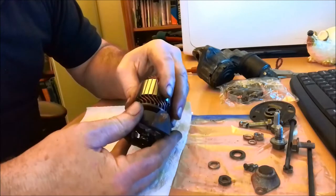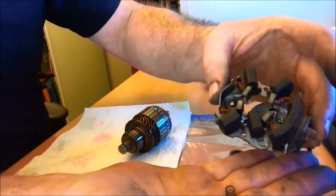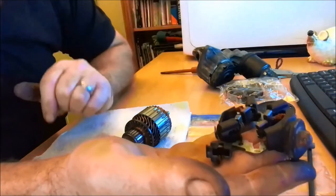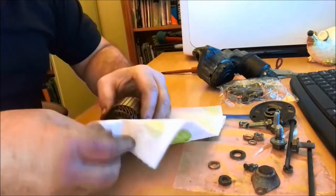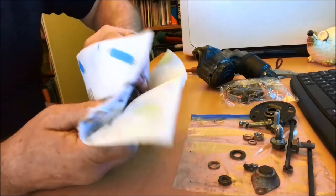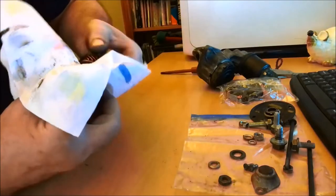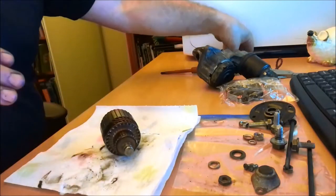Lift the bearing cap off. Inside the bearing cap is like a horseshoe — looks like an e-clip but it's not a spring one, it's just simply a collar that slides into the groove that keeps the armature in place. There's a washer on there that comes off. The cap lifts off — this gets you down to the brush gear. The brush gear from here simply pulls off. As you pull it off, the brushes will come out of the mount because they're all spring loaded. But it doesn't matter because we have a full replacement one here. Just tip that off nice and easy. The brushes have popped — one of the springs has come out, one of the holders has come off. Don't throw that away just yet. I don't throw anything away until the job's complete.